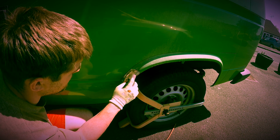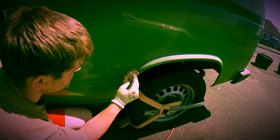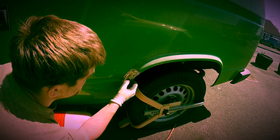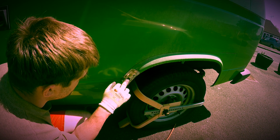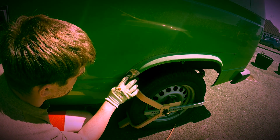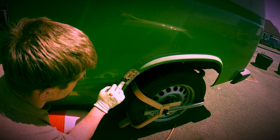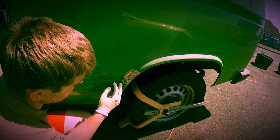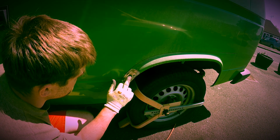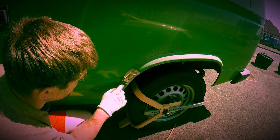It was actually full of filler, and it's actually been hit in, so it's been exposed when the job was done back in 2008. It's just shoved filler in it and hope for the best. That's what they've done. Some of this I'll be able to get away with just puddle welding, just to give a bit more thickness back to the material without actually heating the whole area up.